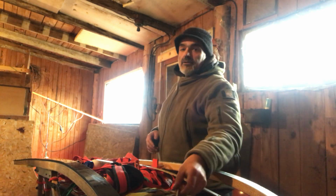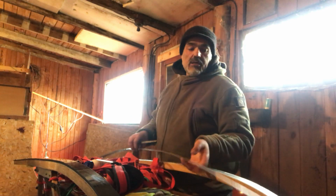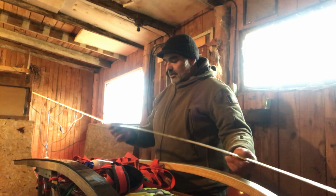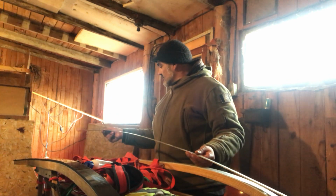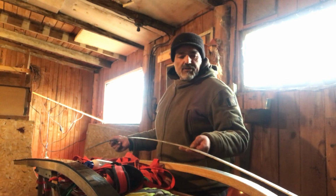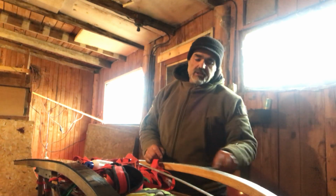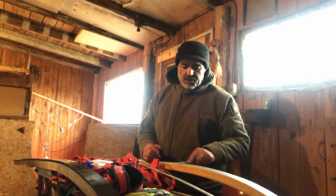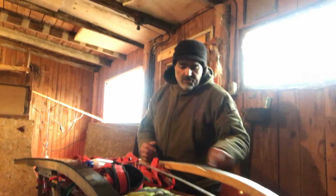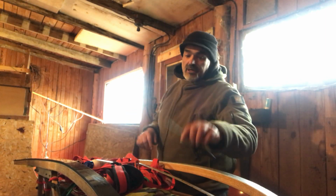So using this triangular rasp, the dovetail portion was quite rough in sections. I spent some time with the rasp taking a gentle rub along the dovetail portion of this part of the rail, and then took the rasp against the aluminum really quickly, not doing a whole lot, just so any high spots were taken out. I had another treatment coming after that, so you didn't have to go super crazy, but I had to do that over there, and I still have to do it over here.